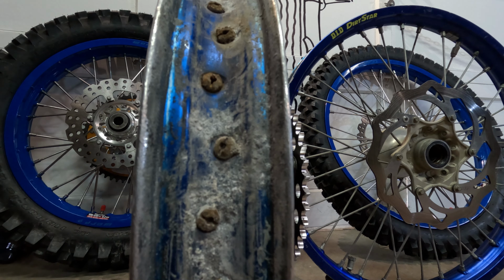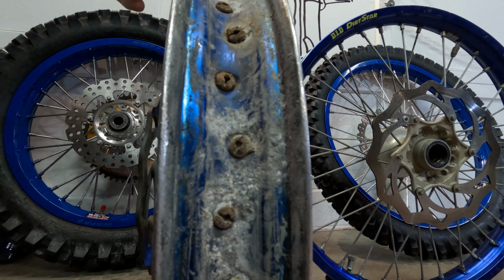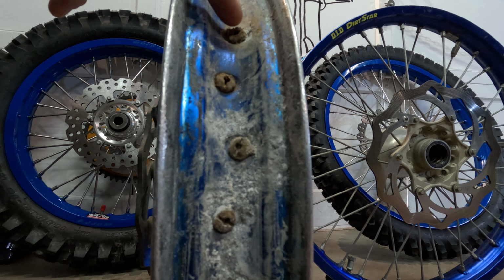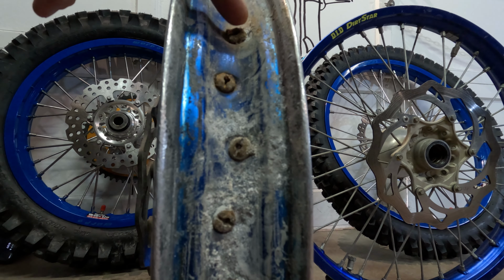The Husaberg rims are very high-end rims, and they are anodized, completely anodized in and out. They're aluminum, and then they're laced with stainless steel spokes. The stainless steel spokes and the anodized aluminum had reacted because many times I've used slime on them, and the slime sort of facilitated an electrolysis, if you like, and it had actually damaged the tops of all the spokes. So to unscrew the spoke heads was almost an impossibility. They were welded in there with years of electrolysis and corrosion.